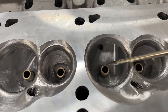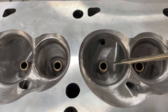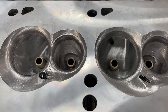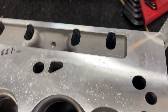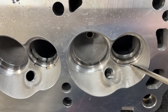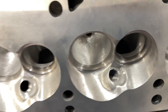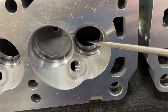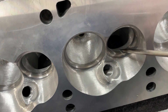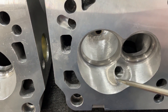You might say that seems awfully big. The reason is I wanted at least some kind of interior transition, so when you make the throat bigger you probably should make the bowl a little bigger too. Now here's the exhaust side. You can see this nasty ledge right here — the valve job's redone but it slams right into a really horrible deal. On the ported one you can see it's been knocked down — I didn't just round it, I actually moved it down and over. Now it's like a normal short-side radius for exhaust, kind of raised up still, but you get the idea.